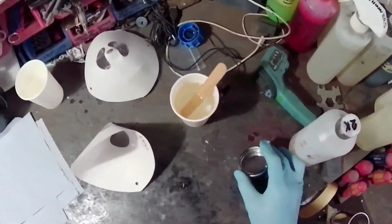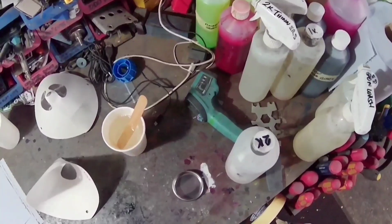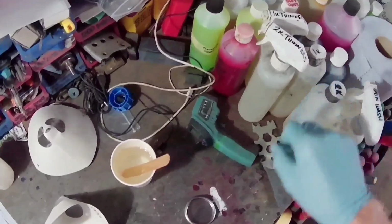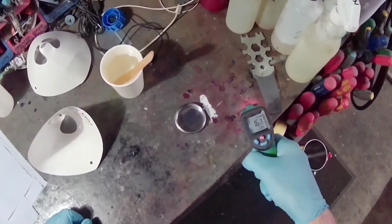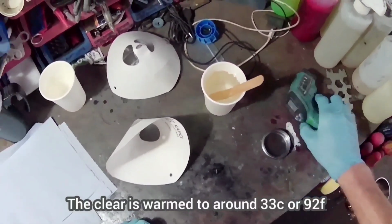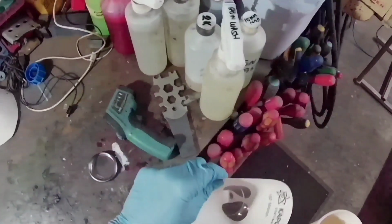and then go off. So you're not reaching the point where it's still staying cold and you might start to get runs. It's not automatically assumed that that's how it will happen, but once you get used to it, that's basically how it does happen. So I'm using a multi-mix 2, and the reason for using that better quality clear coat with these two guns is because neither of them put out a lot of material.